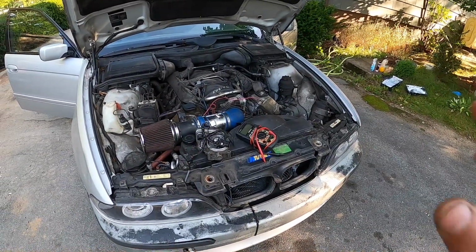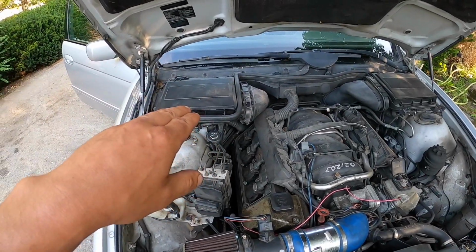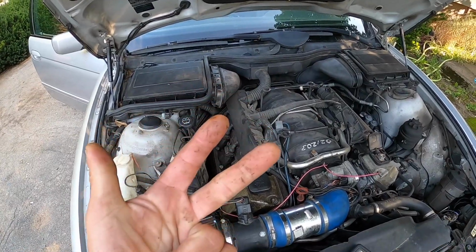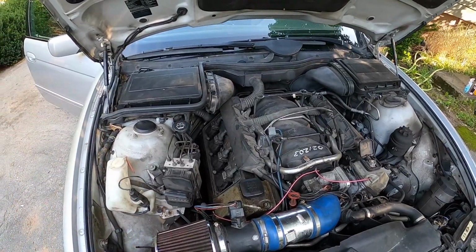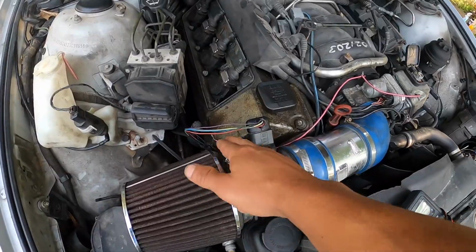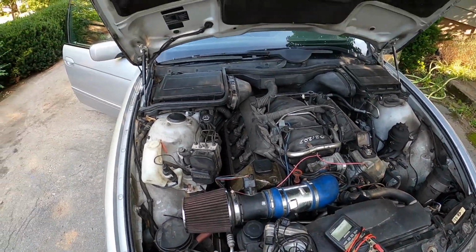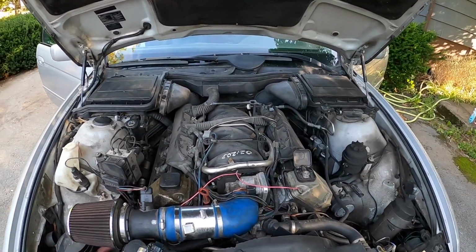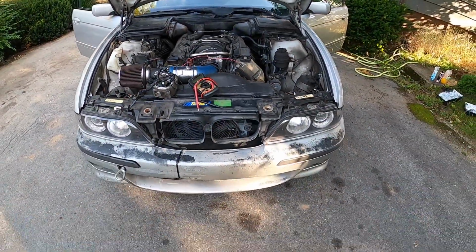But that being said, if the DME is gone in this car, one, it's big money. Two, they're hard to find. Three, you got to take the key, the EWS module, the computer. It all has to be programmed together. So for the simple fact of running a ground wire, I think I'm going to stick to this method instead of wasting the big money on a computer or DME or further troubleshooting of this. It works now, it drives. That's really all that matters to me.